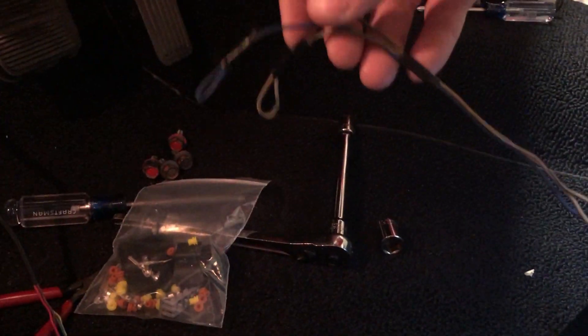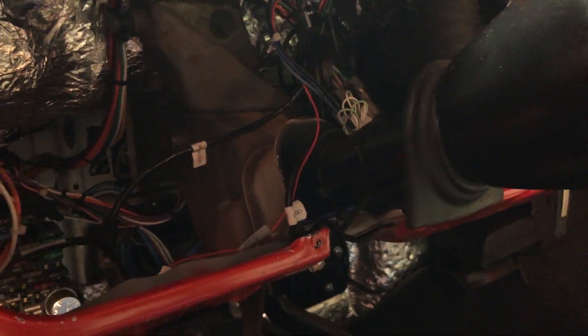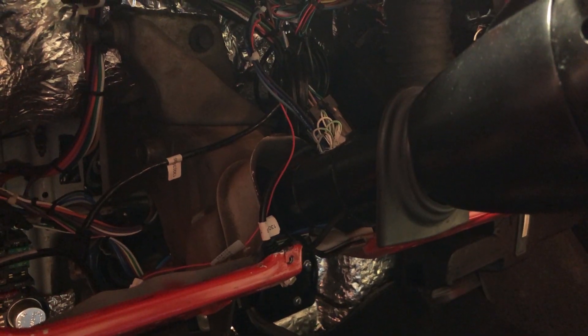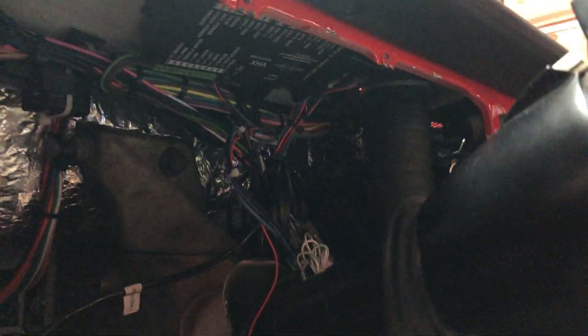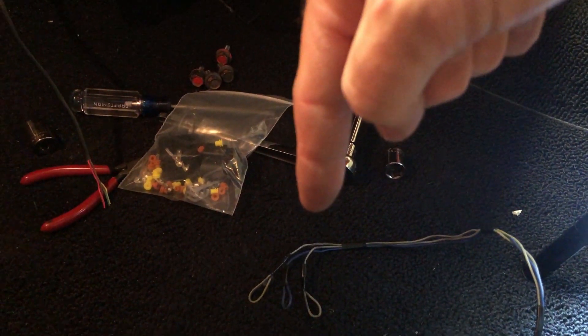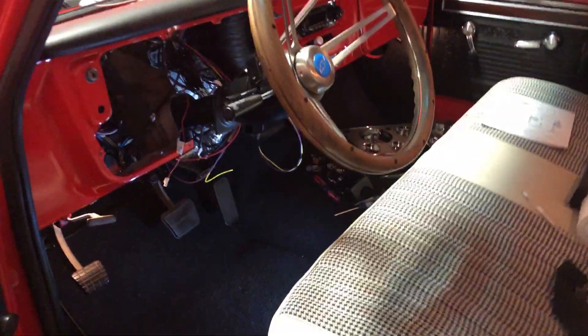What I'm going to do today is extend these wires, run them along and up under the dash. I've got three relays to put behind here — for resume/accel and set/coast — and one that will trigger the light on my Dakota Digital. That's primarily why I took my gauges out, to get to the Dakota Digital box. I need to put a negative trigger in there to trip the light. I've got some extra 16-gauge wire from when I wired the truck.